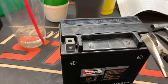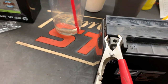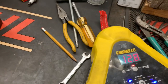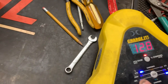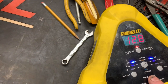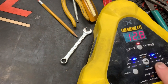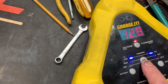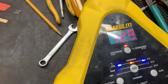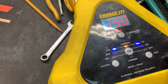Negative to negative and positive to positive, and we're at 12.8. We're going to set this little battery charger to standard and put it on two amps. Preferably if your charger has a float charge, I would use that. We're going to monitor this battery as it's charging — it'll probably go to charged pretty quick.